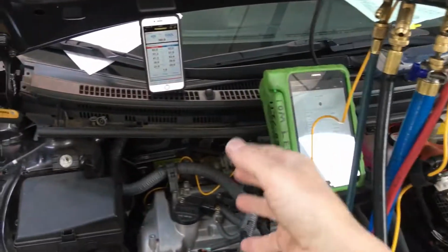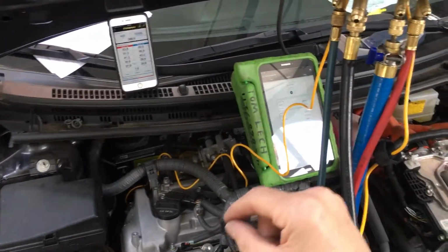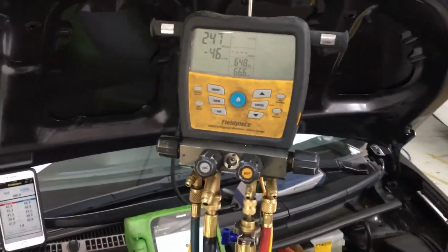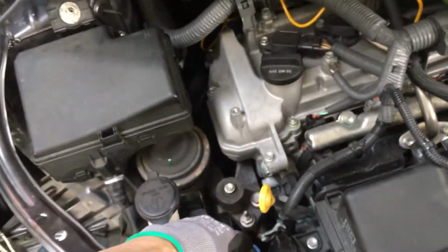If I still have refrigerant trapped in oil, if I had moisture trapped in oil, you're not going to hit 500 microns. It's not going to happen. You're not going to hold. So we have a clean dry system up to this part, right up to the ends of these fans.